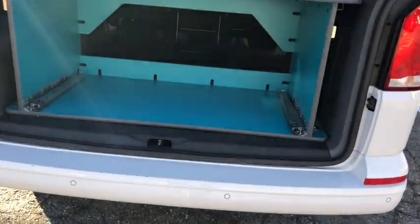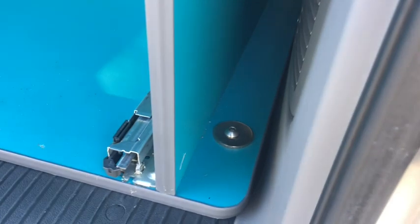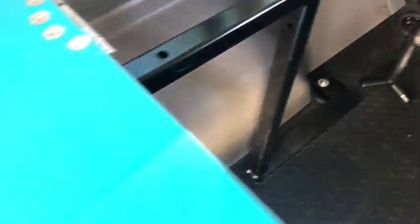Okay, so we've got the shell in and the legs in. It's probably taken me about 30 minutes — a bit longer because I'm filming. So the lashing points have been removed from each corner and these bolts fitted — all of the bolts are supplied with the pod. You just need a couple of Allen keys. Inside, you can see the steel supports screwed in using the original fixing points, so there's no damage whatsoever to your vehicle or the interior.